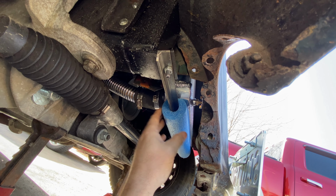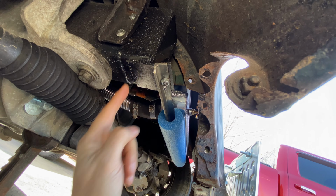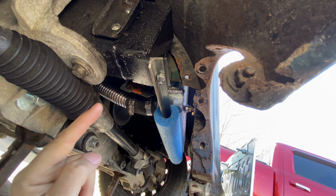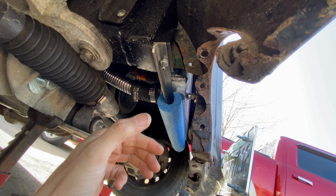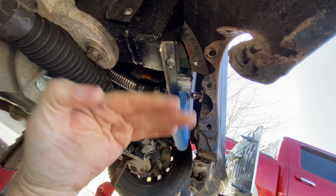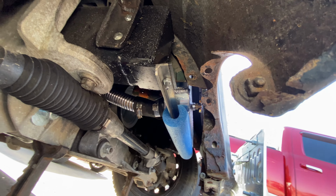So I think that's what I'm going to do. I'm going to find some quarter inch steel, make a bracket that comes down this way, along, add a couple of diagonal gussets. I don't want to make it too heavy, that would be crazy. But it does have to be solid, otherwise your fog lights are going to go up and down. Right, let's go and see what I can make.